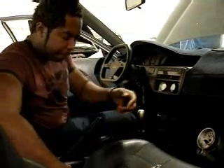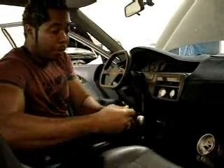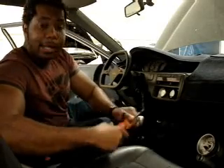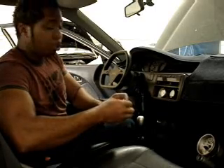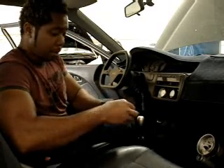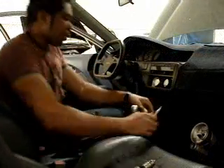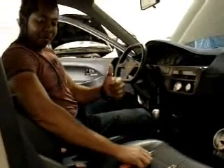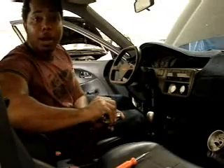Place this out of harm's way. There are some semi self-tapping screws that come in the kit from Autometer. Simply screw into the hole that we just drilled. Voila — first part done. Now it's time to grab the UEGO gauge and throw it into the console here. Connecting the wideband UEGO sensor to the harness is literally a snap.